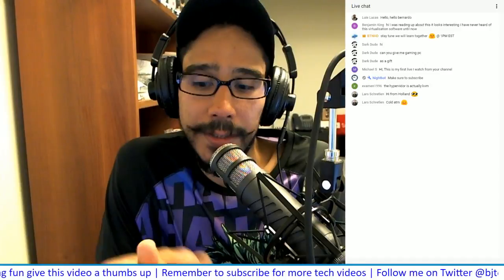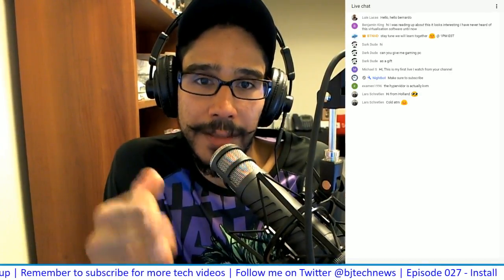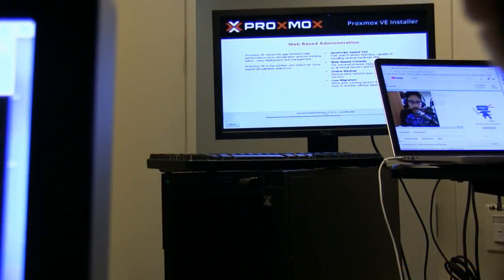Awesome. Then I took a flash drive, inserted it inside my host machine, and used Rufus to burn the ISO onto the USB drive to make it bootable, so I could boot into the ISO and install what we're doing right now, which is this. We're installing it. Then I inserted another flash drive. I opened it up live with you guys, no tricks, inserted it at the back of the server, and we picked that to install the operating system into.